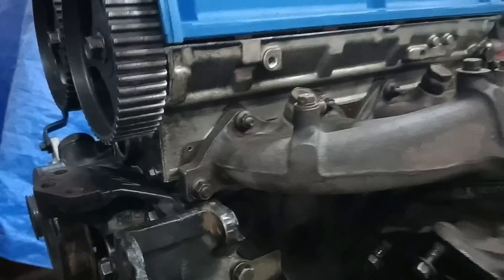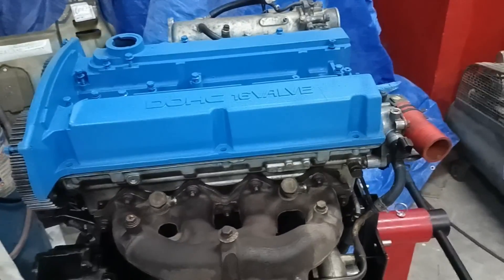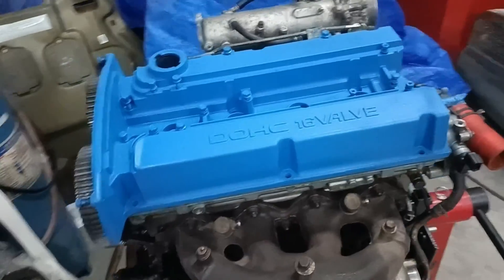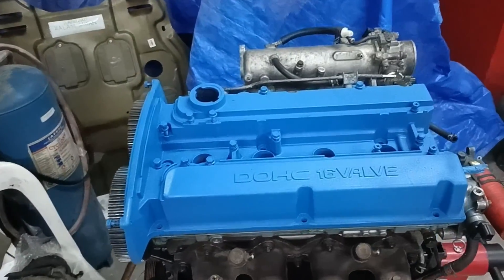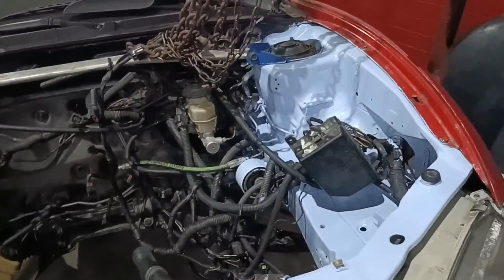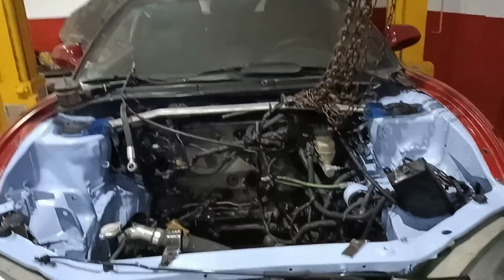The rest of the EVO stuff works on it. This is an EVO 4 turbo assembly and we're using the 4G63 head from the EVO 4 — the head wasn't an issue, it was just the block giving us trouble with the crank walk thing. We decided to reuse the EVO 4 head because the cams and valve springs are better on the EVO 4 versus the Sonata head. We just painted the valve cover blue with VHT wrinkle paint spray — we're slowly painting the engine bay into that color so it's easier once the engine is all in.